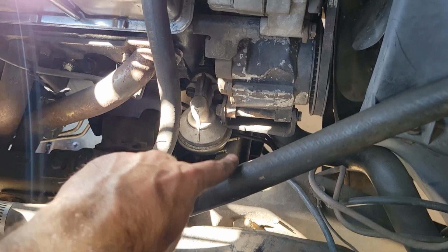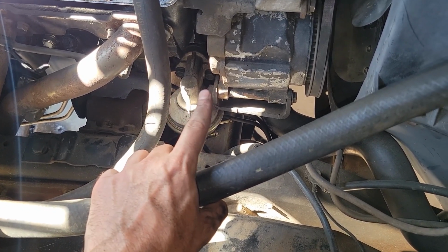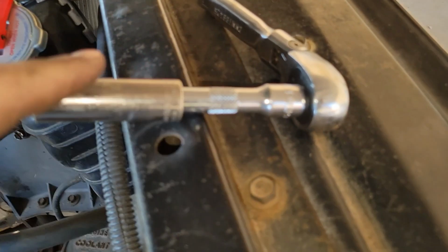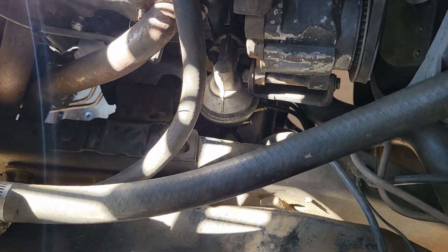Okay, so now that all your hoses are removed from underneath, we're going to go ahead and remove the two 9/16 bolts that are right here. So it's just as simple as, I usually like a deep socket just so I have more room, extension, and then your basic ratchet, but that will be our next step here. So just 1 and 2. Let's get that removed.